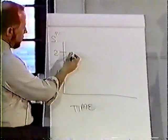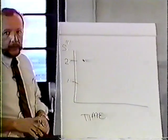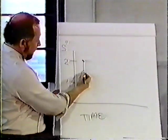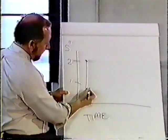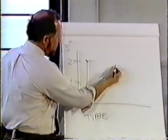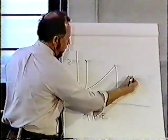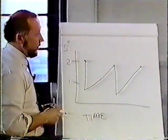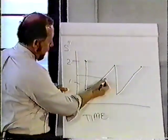When that truck comes in, the stroke might be up here to 2 inches. Remember, on a Type 30, you've only got a total of 2.5 inches. So you do a brake adjustment, you may bring that stroke somewhere down into this area. Then as time goes by, that stroke will slowly increase until we get back up here to 2 inches again. You'll bring it back down, and as time goes by, it will get back up to 2, and so forth. An automatic slack adjuster is consistent in that you will get this type of a line.